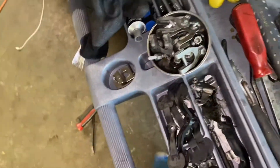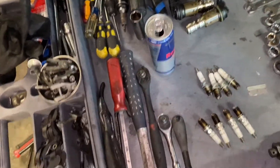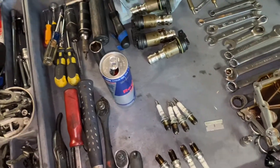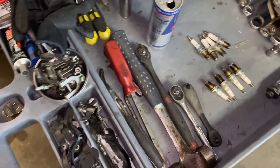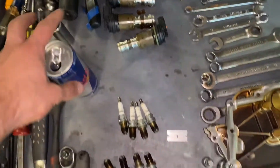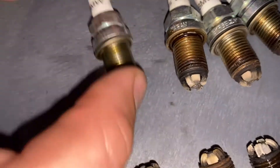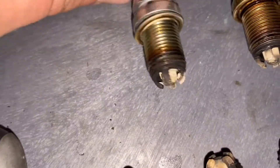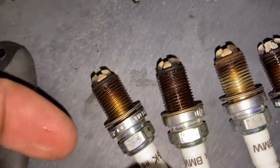This car is very frustrating. I've gone to town for different tools four times now, which - I mean, it's not too terrible I guess, but it's a little bit of a drive and it makes stuff go slow. Once again I gotta go back into town, but I got the spark plugs out. As you can see, this cylinder is burning a good amount of oil - it looks like this cylinder is just really burning it.